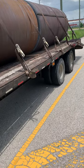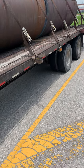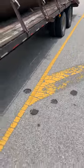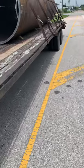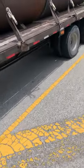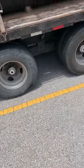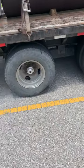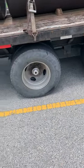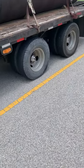I'm going to switch it to the other side, run the double zero on the other side, see if I get the temperature drops — if it's just something to do with that side of the trailer or not, so we have an accurate reading. I think that double zero grease is going to do the job, but if you guys were having issues with leaking seals over and over again, which is a problem I've had for 20 years and seals just don't want to hold up, I think I may have found the solution.